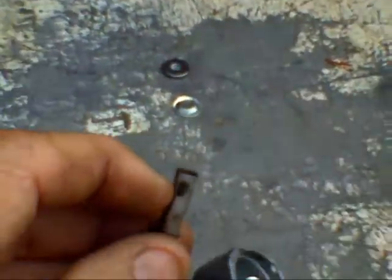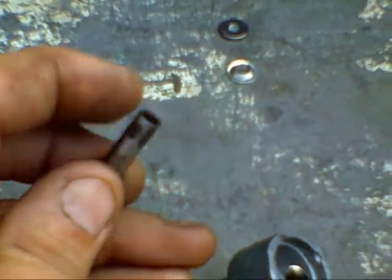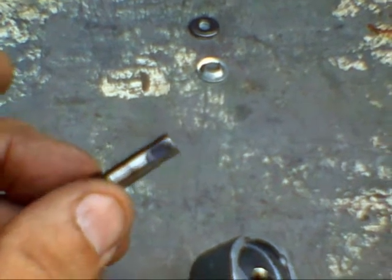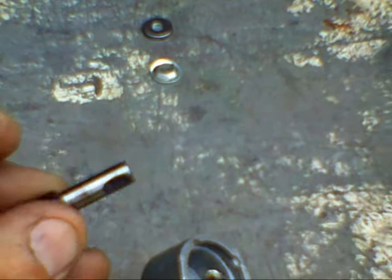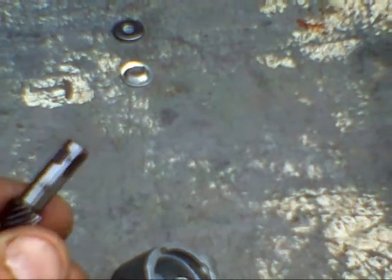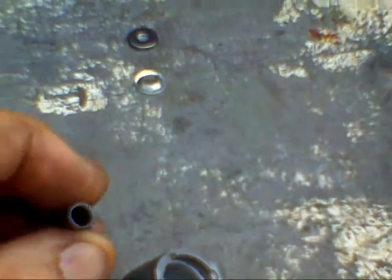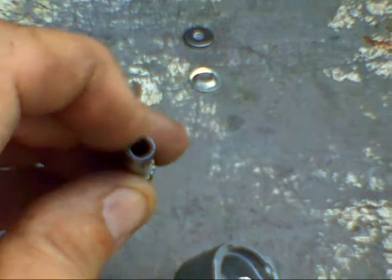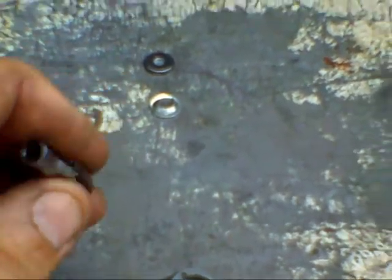The only problem I've found with these mid-2000 Houston units is the crimps in the barrel of the worm gear that hold the lower speedometer cable. Ferrer's got two deep ones and two shallow ones — you're supposed to have four the same size, making a square shape to hold the square end. On my Houston unit, I had two shallow ones and two non-existent ones, so it was barely grabbing that lower speedometer cable. Eventually it would just spin and wouldn't grab. The fix: drill a couple of holes in the shaft so JB Weld has something to sink its teeth into, fill it with JB Weld, and sink a piece of one-eighth-inch square steel tubing in there and let it dry. When you pull it out, you'll have a perfectly square receiver for your lower speedometer cable. Once you do that, these units are fine.